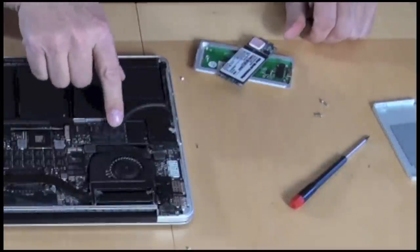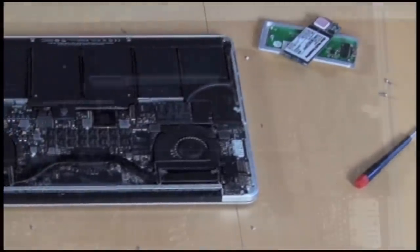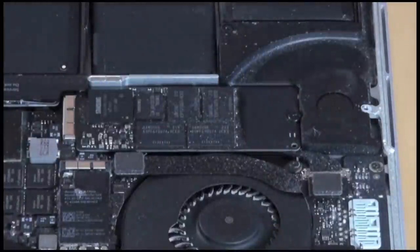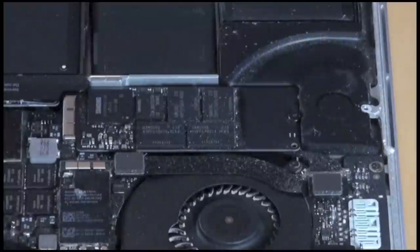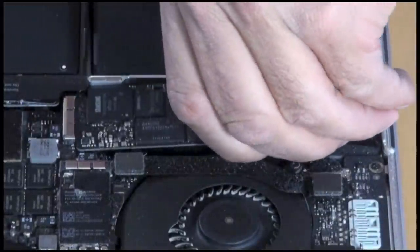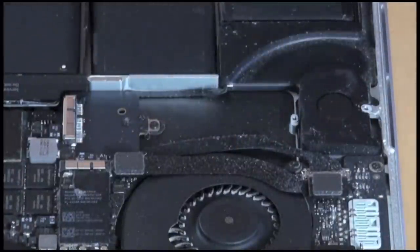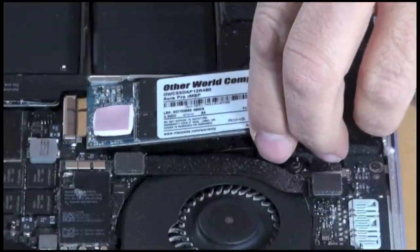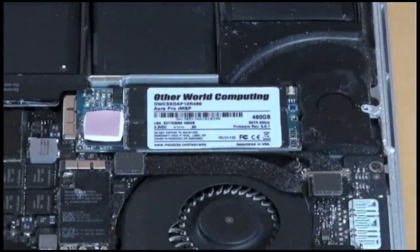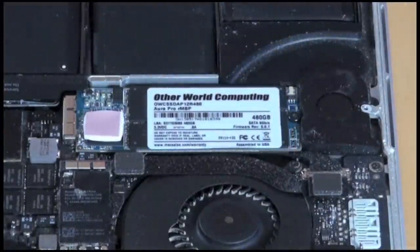So what we need to do is slide it out, and there's a single screw holding it in. Let me zoom in for a second so you can see what I'm talking about. Okay, so now you can see right here — that's what we want to replace with the new unit. We take our existing screwdriver, there's the single screw. We take that screw out, and the drive pops out. Pretty handy. There's only one way these things can fit because of the way the slots work. Now we'll put the new one in, with gentle little pressure, and put that screw we just took out back in. That's all we got to do.